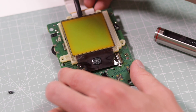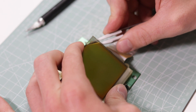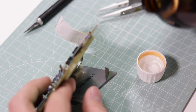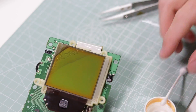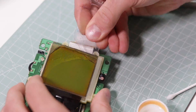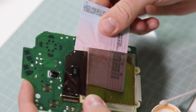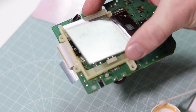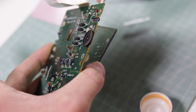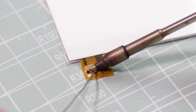After the screen has been repaired, it's time to get to work on the backlight. Lift the screen out and grab your Dremel. Gently separate the reflective film and polarizing filter off the back of the glass — I do this by lifting one corner and using isopropyl alcohol to dissolve the glue. Unfortunately, this causes unwanted residue on the screen, but it is the safest way to tackle this mod. Grab the backlight and solder the two included wires to the respective pads. This kit is available on Retro Modding.